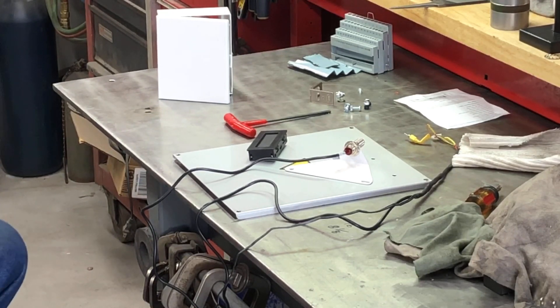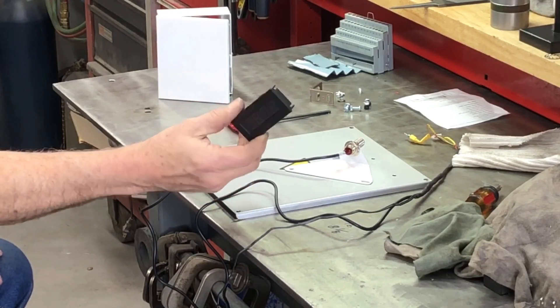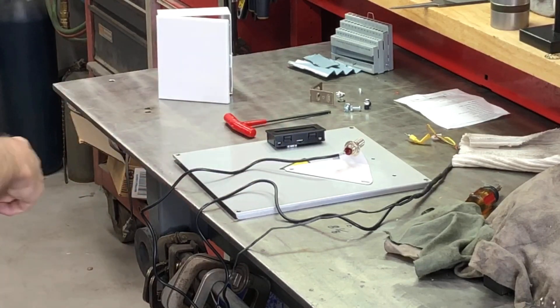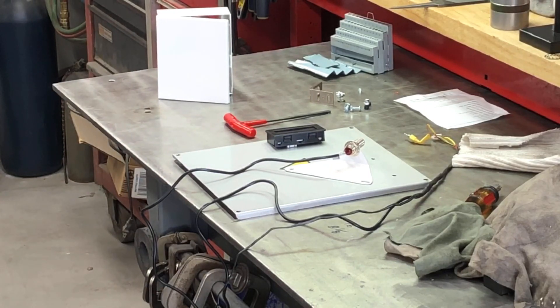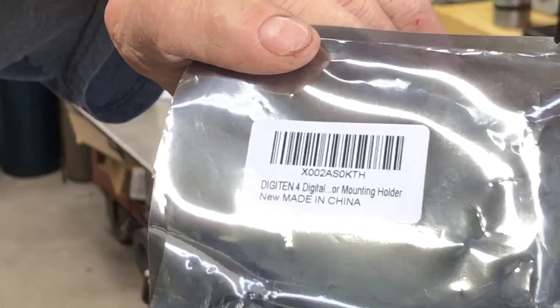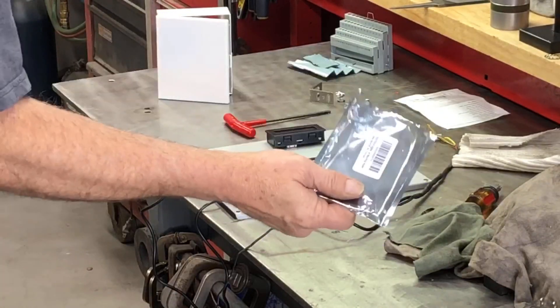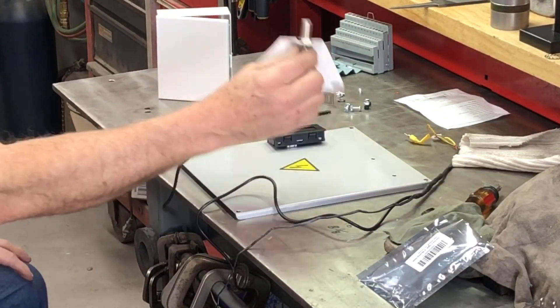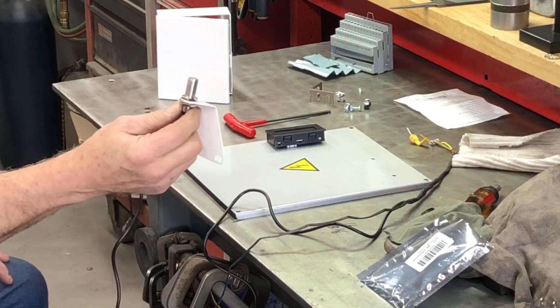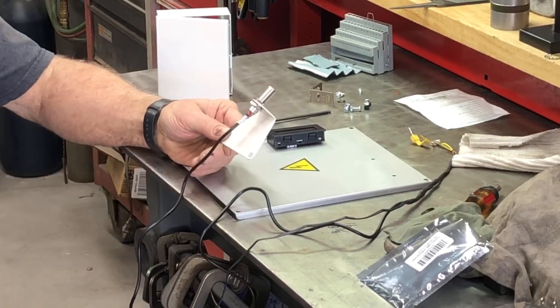So, Kim here, Poppa's fix-it-job. What you're looking at here is a tachometer. It comes with a pickup coil. This is a Hall effect, if you know what that means. Basically, it measures a waveform from an interrupted magnetic field.